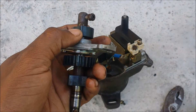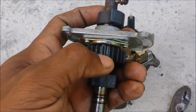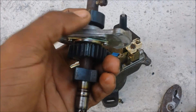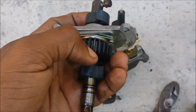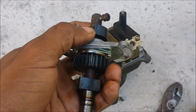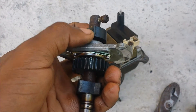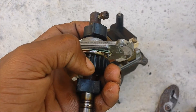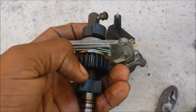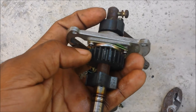This tooth aligns with that tooth. If you follow along, you'd realize that if we can get sequential with 24-plus-one, then we can get 24-minus-one to work as sequential as well. The missing tooth would basically be doing the same job as the single tooth. So this tooth lines up with that one — you can just remove this tooth and it'll be 24-minus-one, the same thing as plus-one.